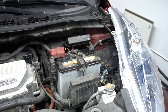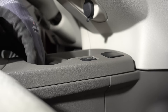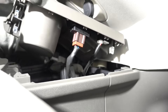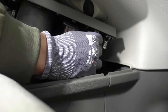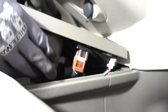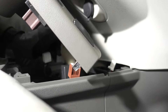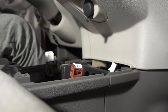Let's move inside the vehicle. Inside the car, start with removing the cup holders. This does not require any special tools — you simply pull up to remove it, like so. Then there are some electrical connections inside that you have to disconnect. One, two, three, and four. Then just place it on the side.